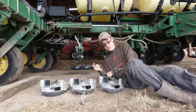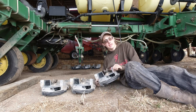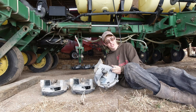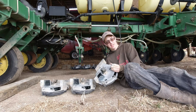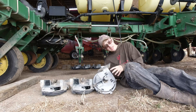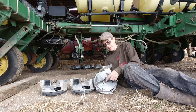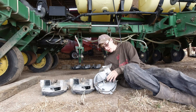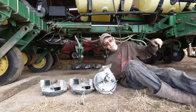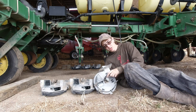This is the meter that's on the corn planter. These specific ones are made by Precision Planting Industries. These are called ESET meters — not exactly sure why, that's just what they named them. These are all chain driven off of the wheels, so the wheels on the planter turn, they turn chains, which then come up and turn these. That's how these ones run.